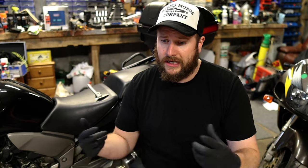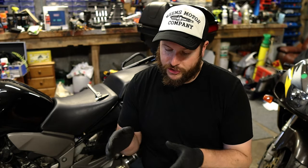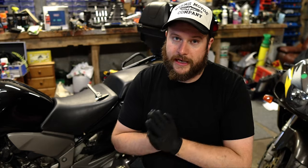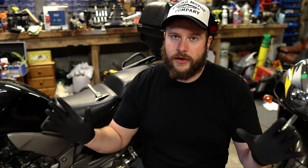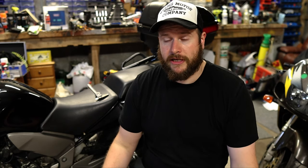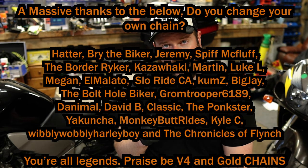If you have any questions whatsoever about this job, please do not hesitate to ask me in the comments — I can make shorter videos and try to help you out, or even on Instagram. I think this is like a three out of five difficulty job. It's patience, patience, patience with doing the chain. Don't rush things, don't push the face plate too far, don't crush the rivets too much — that's what's going to get you. But even if you do that, you can just put on a new master link — it's not the end of the world, you haven't ruined the chain. Thank you very much for watching, and a very special thank you to my patrons — I know one or two of you have a CBF so I hope this is helpful. Until next time, adios.